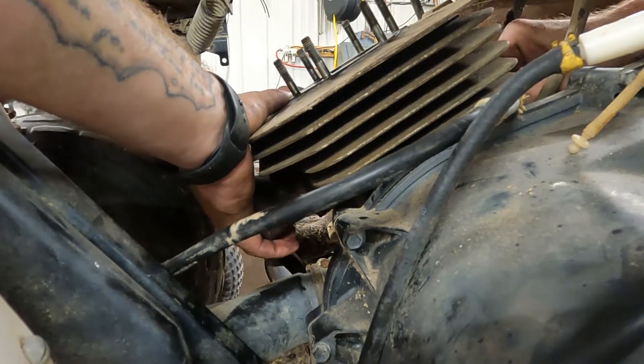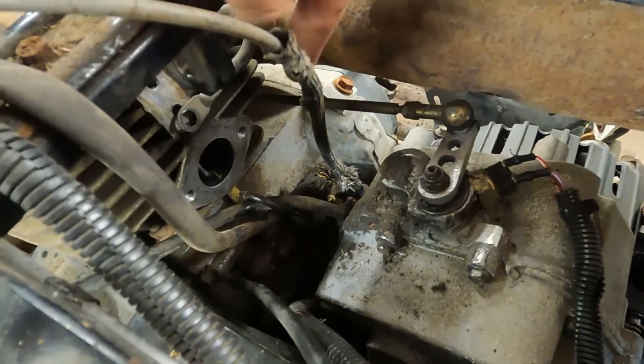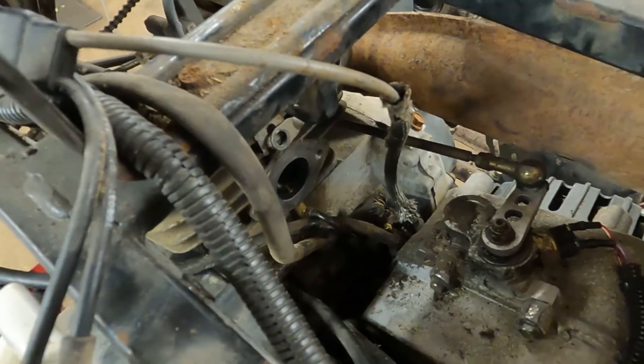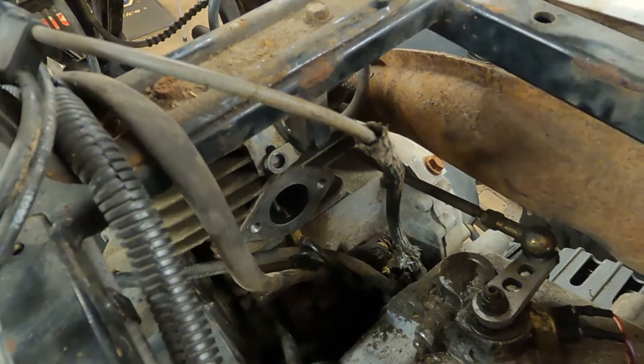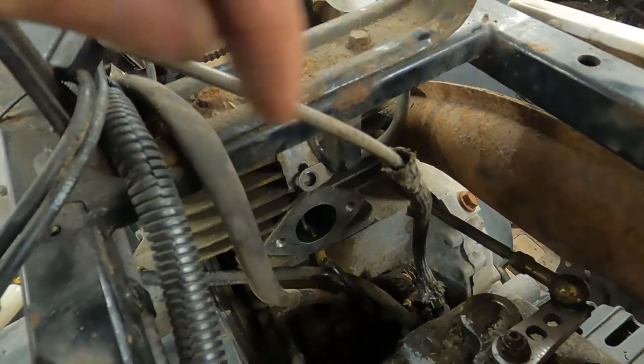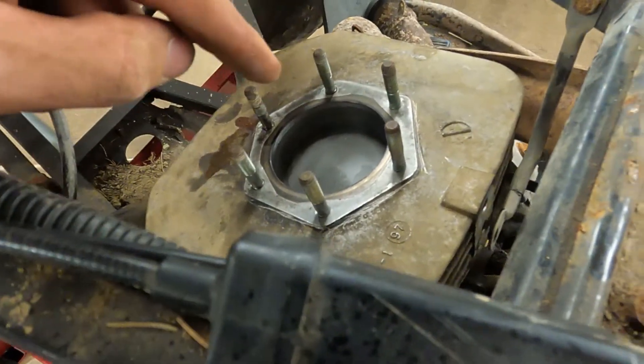I'm going to hook up my oil line right now because I'm right here. I like to get at least one nut started to hold the cylinder down, then I'll pull the recoil and roll the motor over slowly by hand just to make sure there's no snags. I put the nut on the cylinder to keep it down — if you don't, as the piston comes up it'll just pick the cylinder up. Some of you experienced guys are going to haze me for this, but there's no way I can get a torque wrench in there. I was told that by hand, if you've ever turned a wrench before, you should be able to get within five foot-pounds by hand — fairly consistently. I don't care what all four are at as long as all four are fairly close to each other — you want even torque all the way around.